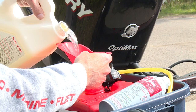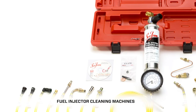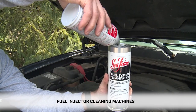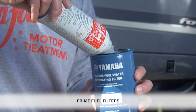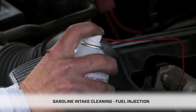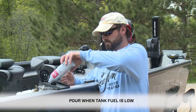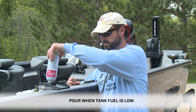There are several ways to use high cleaning concentrations of Seafoam. Professional mechanic shops all over North America use fuel injector cleaning machines to deliver high concentrations of Seafoam through gas and diesel fuel rails. You can prime diesel marine fuel filters with straight Seafoam. When using Seafoam spray through gasoline intakes, you're running a full can through the chamber in four minutes. And of course, we use a greater cleaning concentration when we add Seafoam to a low tank of fuel.